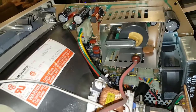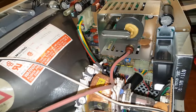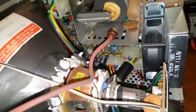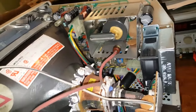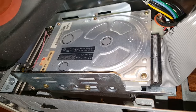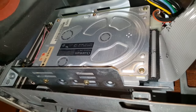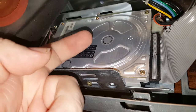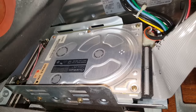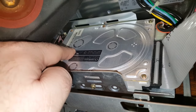Nothing stands out as any serious or major failures on the analog board. I have not attempted to power this machine up since I purchased it — I want to do a full restoration before doing that. It has the typical 40-megabyte Quantum ProDrive. These drives are notorious for the actuator arm sticking; I did a video years ago about it. I had to take the lid off and move the arm to get it to spin up.